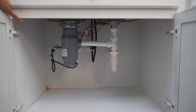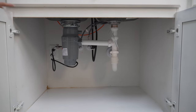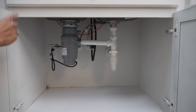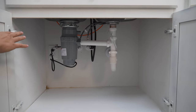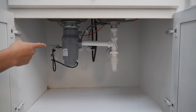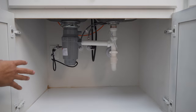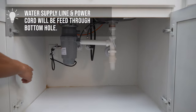The other thing is the water supply line — it's either going to be CPVC or copper piping. You want to identify the shutoff valve that's feeding the dishwasher. And finally, as far as the connections, is going to be your electrical. If your dishwasher has a plug-in, it's going to plug right into the outlet located under your sink. The final thing as far as the installation goes is where your lines are actually run.